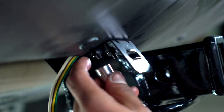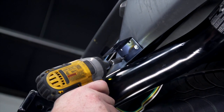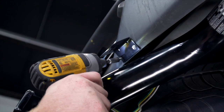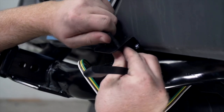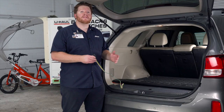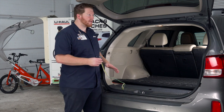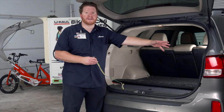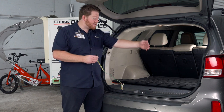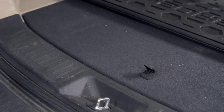Using the screw and nut will help keep it in place and secure for a longer time. Now if your bumper fascia is metal, you can definitely go ahead and use your self-tapping screw, since that tends to hold better on those harder surfaces. Our next option is to leave our wiring in our cargo area. If you're already installing your trailer wiring behind your paneling by connecting to your tail lights, it's easy to just leave it right here in your storage area, either by your spare tire or in one of your storage trays.